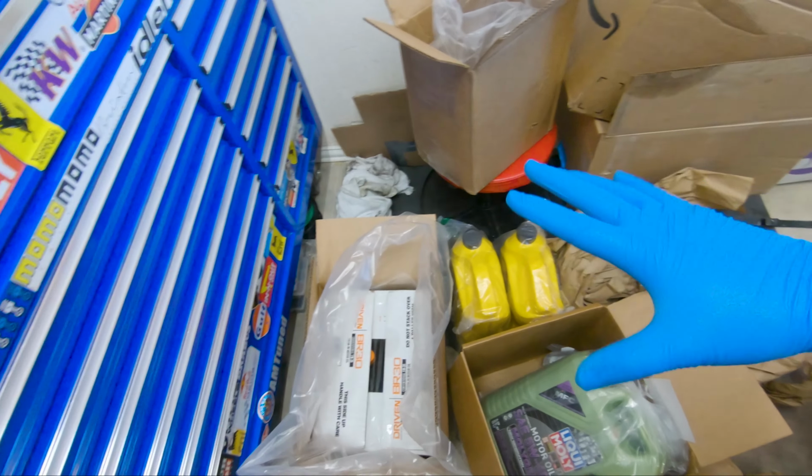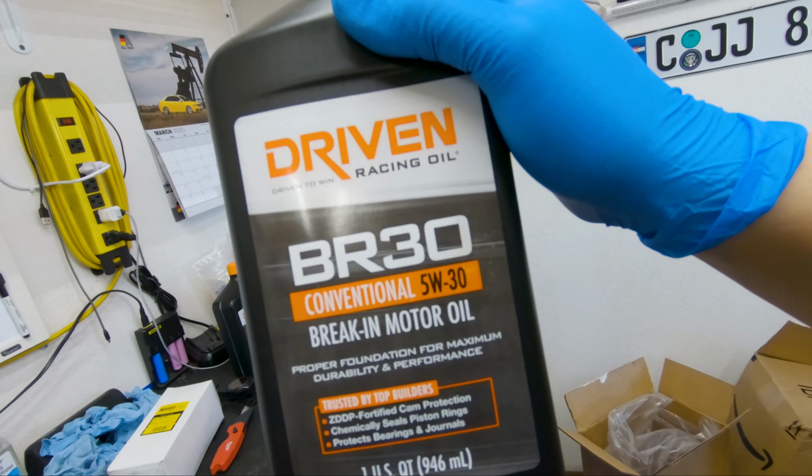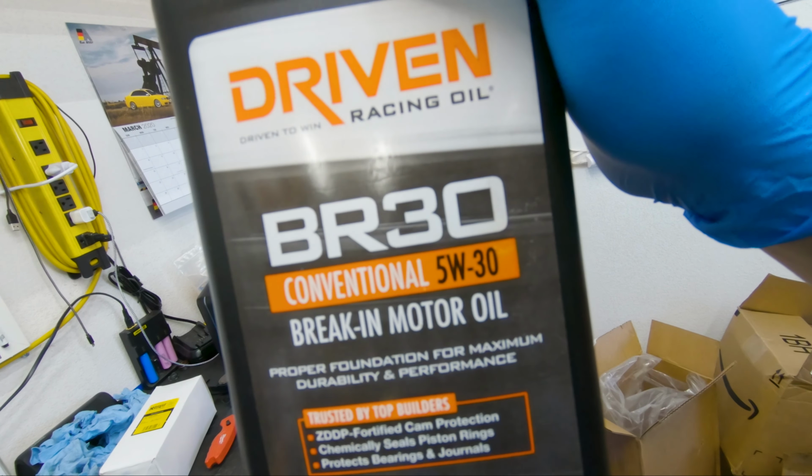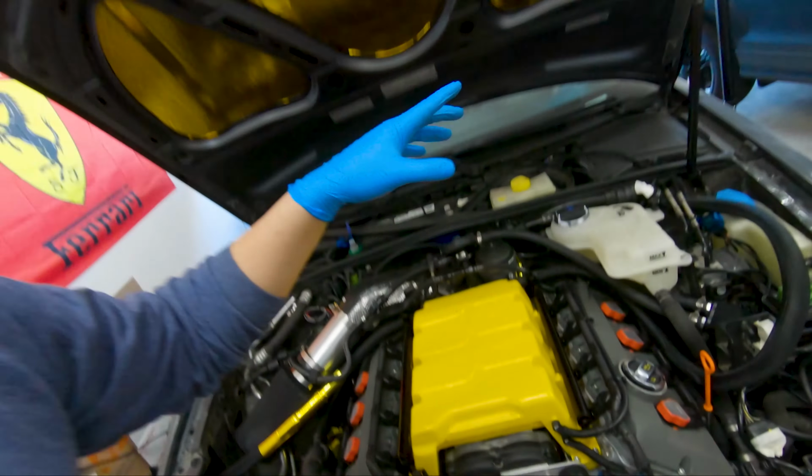So I just had to pause real quick because the FedEx guy came by with a box full of goodies, and it's mostly all oil. Real quick, and again, I'll go into way more detail in the process when this happens, but that'll probably be happening in the next video in the break-in part. I got myself this break-in oil, driven conventional, which is really important, 5W30. That stuff is really pricey, and I had to get a whole lot of it because I need to do a total of 2 oil changes with that. And since this thing likes to guzzle down 9 quarts, and since it's bare empty, I'll probably use up all 10 to get it all through the nooks and crannies in the engine.